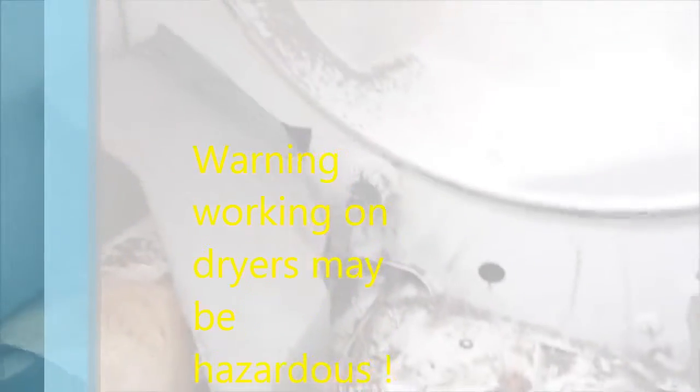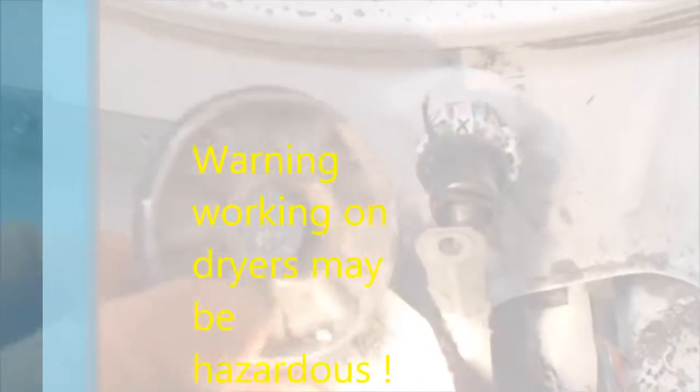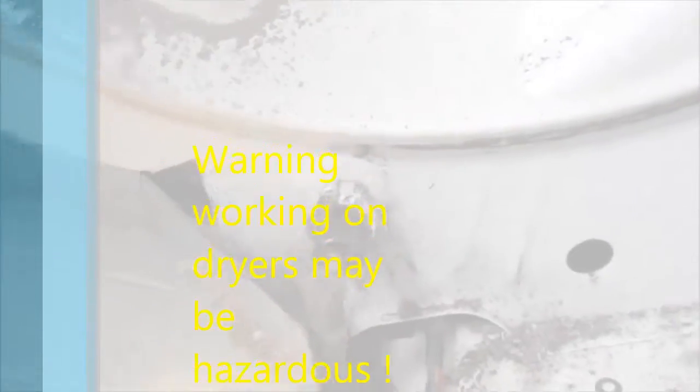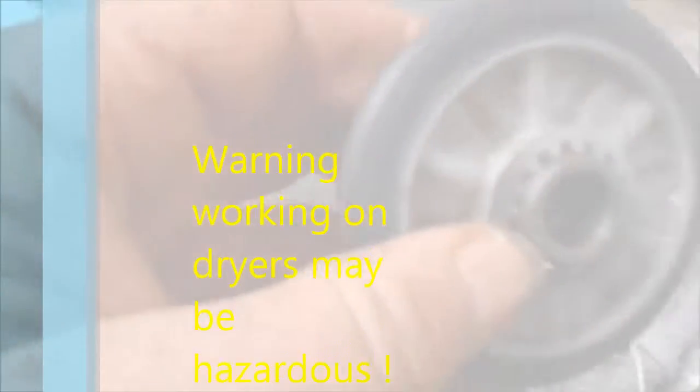Let's take a closer examination of this roller. I pulled the roller off and basically it came off in two pieces — this piece here — and the bushing is still on the shaft. These two surfaces were not meant to roll on each other; this will wear out and cause problems and get floppy. It's meant to roll on that bushing right there, and that bushing was probably frozen on the shaft. You heat it up and it came loose. Here's a good used one — this is what it's supposed to look like: it should have integrity, and that metal bushing is supposed to be attached to that roller.